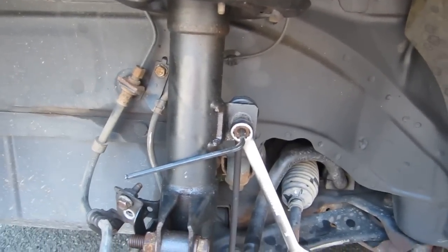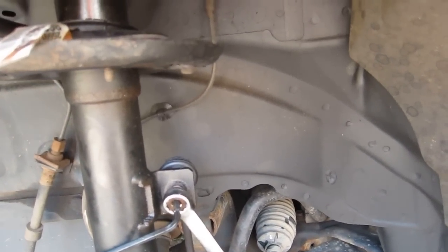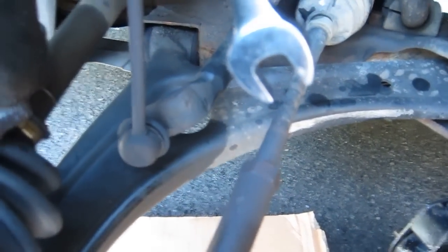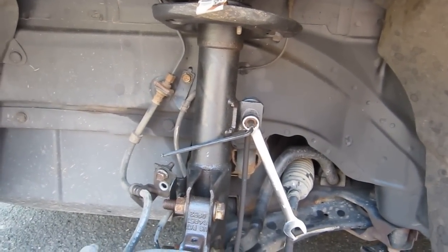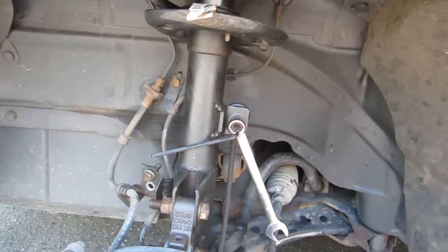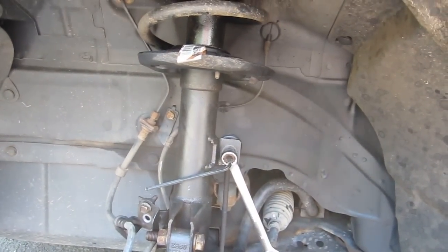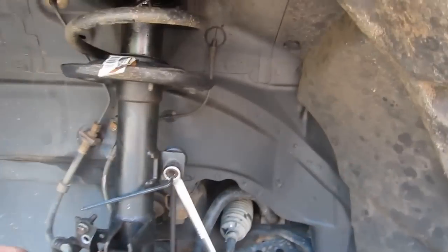We're getting bad clunking again. Here you can see I removed the tire — here's the strut assembly, and the boot is ripped. That was my first clue. The second clue is there's oil leaking all the way down back to the control arm over here, seeping oil everywhere. So I'm pretty confident the shock is bad. It's been getting really bad clunking on the road, worse than what the control arms sounded like. There was no tire wear this time, though it sounded very similar. Usually with control arms clunking you'll get some tire wear, so I'm hoping it's just the shock alone. The shock is obviously bad, so there's no harm in buying the part and throwing it at it.